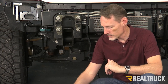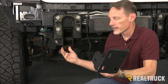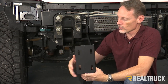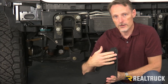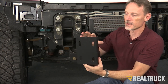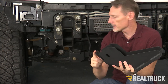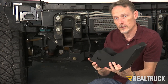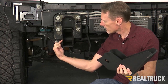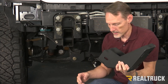The first thing I'm going to do is take the new Road Armor bracket and install it into the factory frame horn. When you look at this bracket, you've got a large plate here. The ear of the bracket will go to the outside of the truck. This portion right here is the top. So the tongue is actually going to go inside the frame horn and rest on top there. These two oval shaped holes will line up with a couple of holes in the frame horn and we can go ahead and attach it.